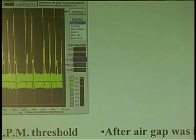Because computers don't like high voltage. And some of the older computers couldn't clip AC. AC can just be runaway. So there's a certain threshold that has to be. If it gets beyond that threshold, it creates problems. Without a scope, you would never, ever find this problem.